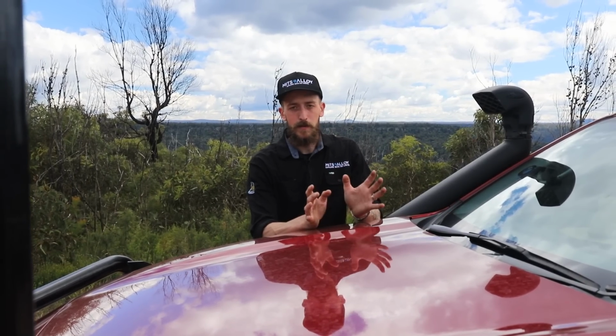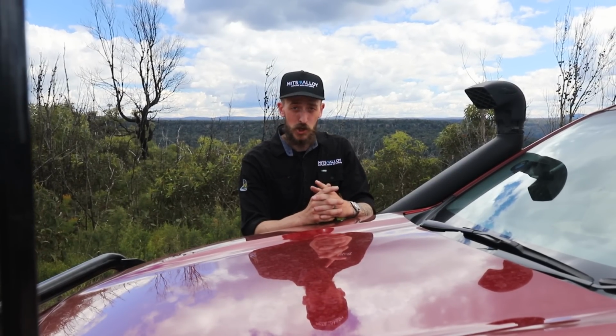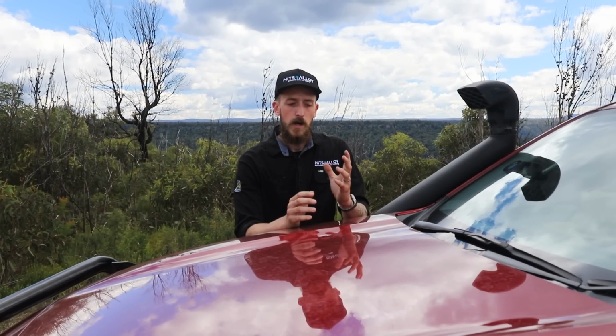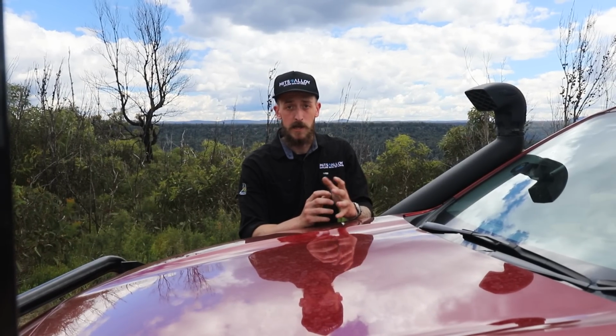So I'm a little bit biased. I'd say the Terrain canopy, but if I had to choose something else, honestly, it'd have to be the Tune. Before that, definitely a reliable motor straight out of the box from the factory, but when you do load it up to 2.5, 3, even 3.5 ton, it bogs down like you'd expect any dual cab ute to. So when we took it to see Tommy and Liv from Performance Tourers, they essentially unlocked a lot more power out of that motor with the AlphaTech Tune, and now it's running 180 horsepower and 580 newton meters on the second stage of that Tune.